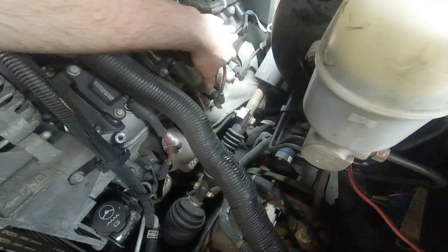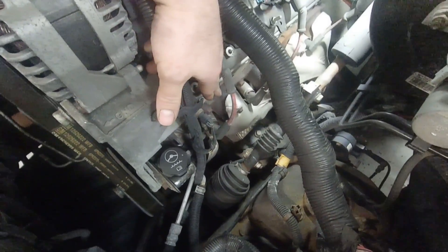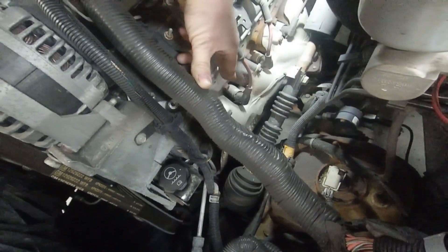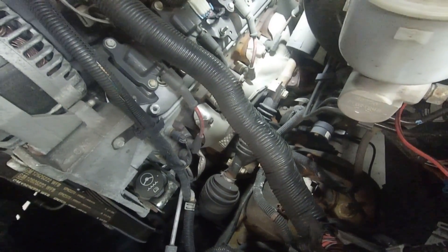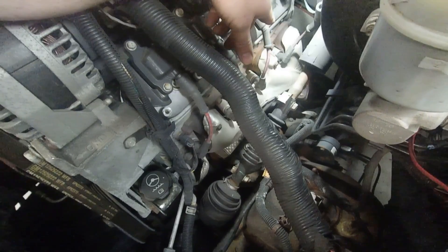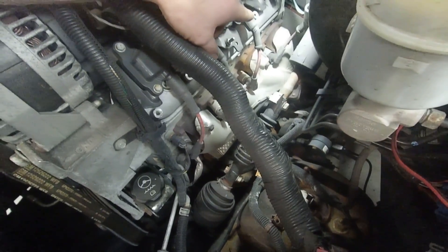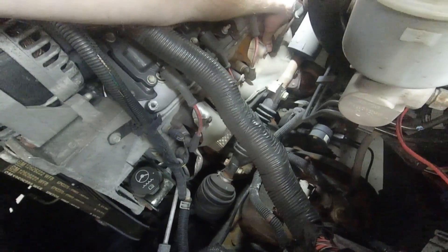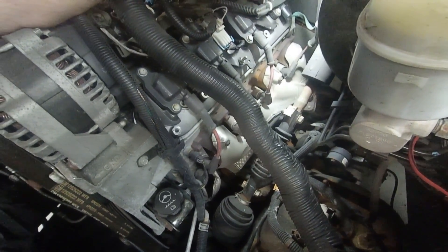There's some black soot right here — that's where it's actually leaking, puttering out of this manifold gasket because of that broken bolt. When one breaks, it starts out making a real small amount of noise on startup. If another one breaks alongside it, it makes a lot of noise. The ones in the front will break after a while too. When you go to repair these, sometimes you'll break more off trying to take it apart — there is a trick to getting them out.